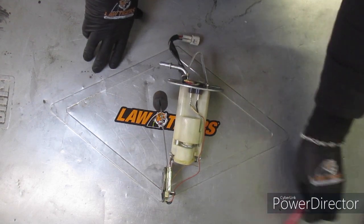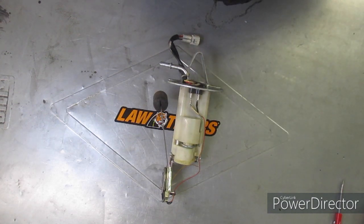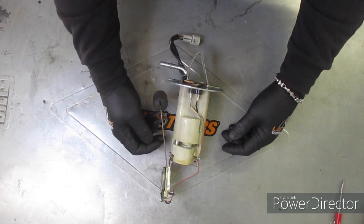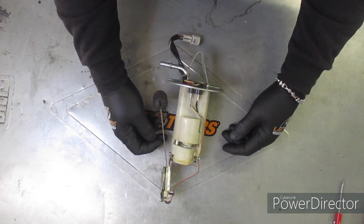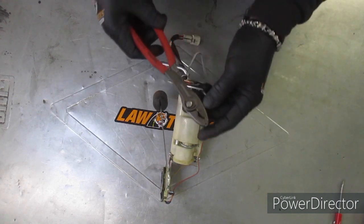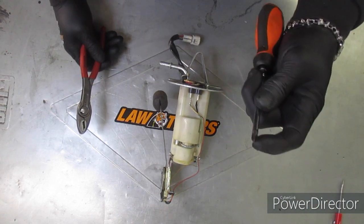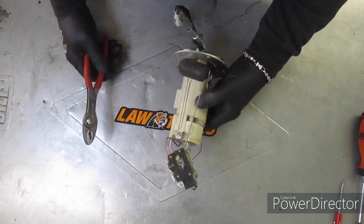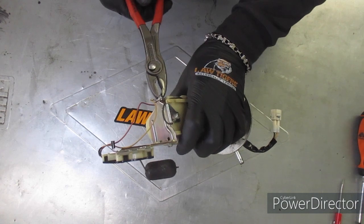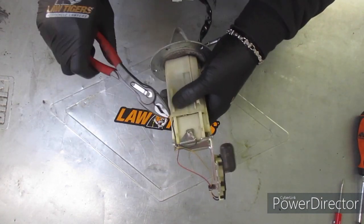It just ain't doing the response that we want, so let's tear this apart. I went ahead and broke some screws loose. Sometimes these Phillips screws here don't want to break loose. I got a pair of pliers that I use that actually helps out pretty good. These pliers work really well taking out screws that don't want to go — the Phillips kind of rounds off even though you get the right size. See how that's got a little arch there and it fits perfectly on that little round head and you can just pop it loose. That way you don't chance messing up the Phillips screw head.